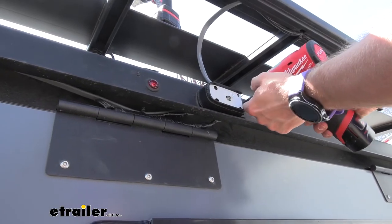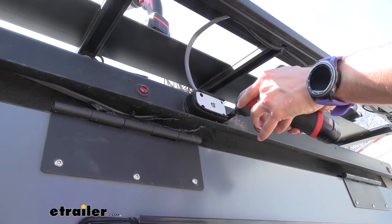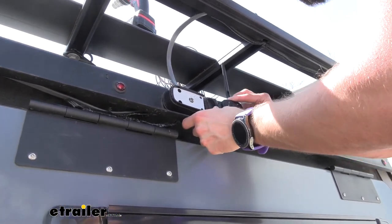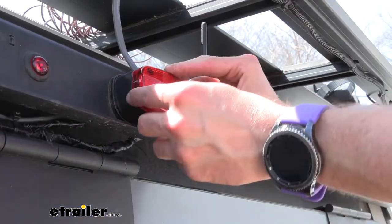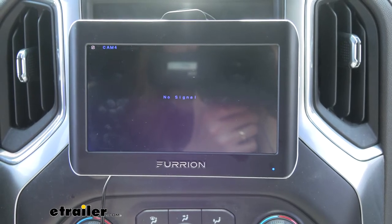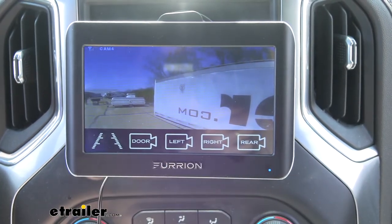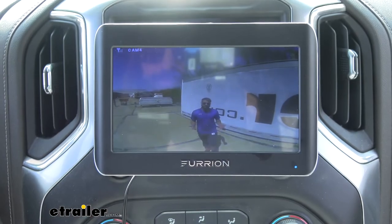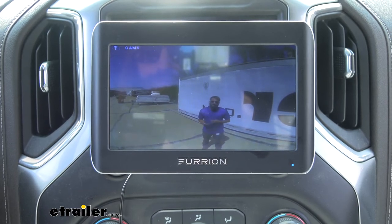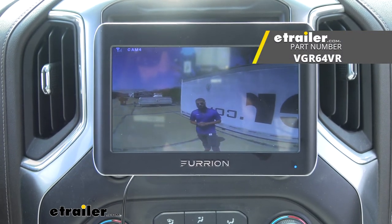With our wiring in place, I'm going to go ahead and start mounting our camera back onto our camper. We can slide in our actual camera — not our monitor — and now we can pop on our cover, get the camera kind of back where we need it. Now we can go test it out. Now we're in the cab of the truck. Let's go ahead and flip on our power. And as you can see, our rear is now working. You can see me now. So that solves our issue here with the pulse width modulation coming from our newer GM and Chevy trucks. I think that about does it for today's installation of the PWM filter from Voyager here in our 2020 Taxa Mantis travel trailer. My name's Kevin, thanks for watching.